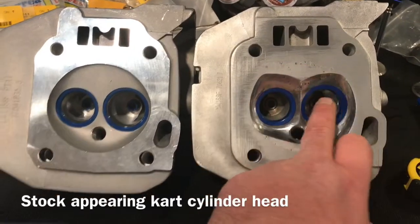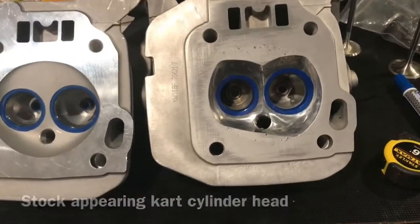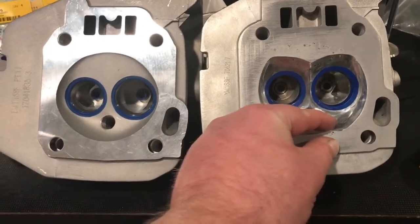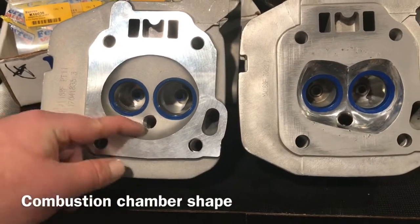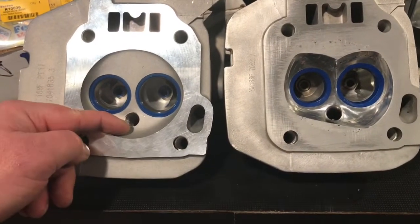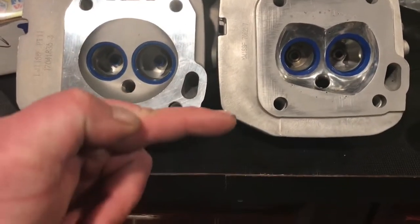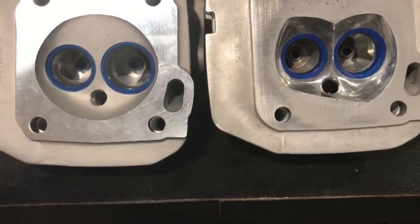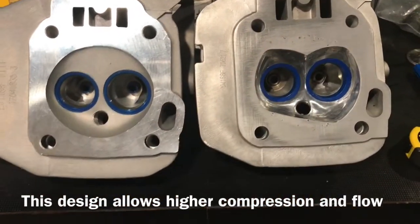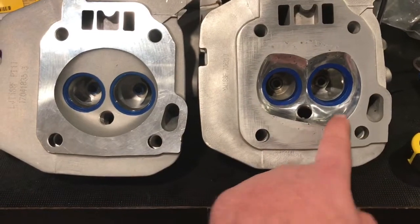If you see the pockmarked areas by the top and the bottom, that is the original shaping. This area here was just filled with weld and this area down here was filled with weld. All of this material — that's a lot of material to be filled in, especially down in this corner here, all the way level to the spark plug. It's about a finger's worth down in here, which is about 10 cc's of volume. Then up in the top here, some material has been taken out, so we've kind of added some but taken some out.